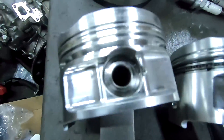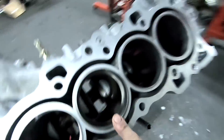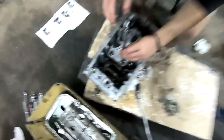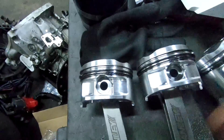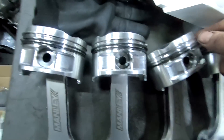I've been slaughtering this one, trying to keep it super clean. Got all the bottom rings gapped, two of the top rings gapped, working on the third top ring right now - just filed it, still needs to go a little more. Eric's tearing his motor down - he just got the pistons and rods out, he's working on the crank now so he can get this thing decked and back in his car. I think he's gonna have it sleeved this time and he's going for a little bit more power. Got all the rings gapped, situated, organized where they need to be on the pistons - everything's all perfect.